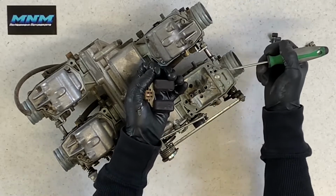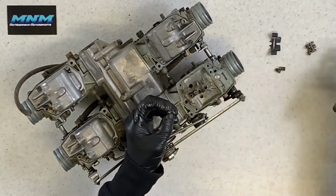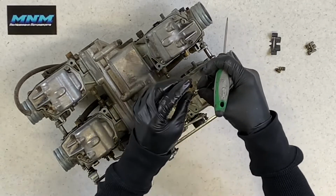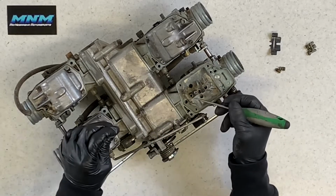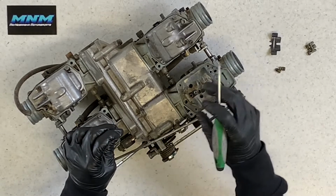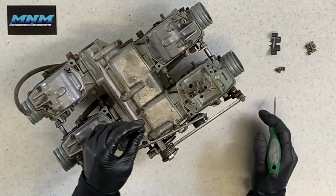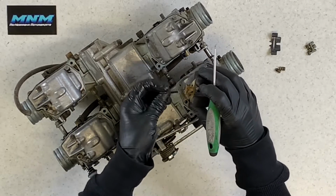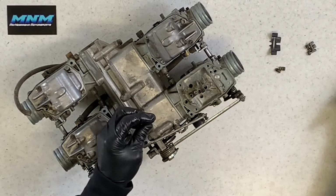Leave a comment below if you want these specs, but you want to make sure that this float is set to the correct adjustment. Don't just slam it up and down depending on if you've got fuel dripping out of your carburetor constantly, because what that is doing is potentially not letting enough fuel into your carburetor, not allowing enough fuel to get to that cylinder. So I don't want you to starve your bike for fuel just because you went and pushed this pin up or down too far. Make sure you make those measurements before you go adjusting that tab there.